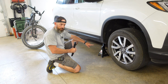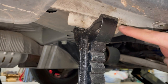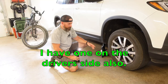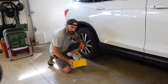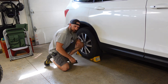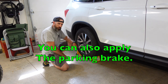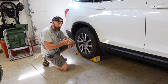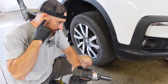Right here is where I put my jack stands. If you look up under there, this big piece of metal here — you can put your jack stands on. I've got mine kind of under there for safety because I'm gonna leave that floor jack on there with the car jacked up. I'm also gonna put a couple of wheel chocks in the front and the back of one of my tires just for safety. If you don't have them, you could just put a piece of wood in there to be extra cautious so the car doesn't move at all. If you're gonna use an impact gun like I am, it wouldn't hurt to have hearing protection, and when you get under there, some eye protection.